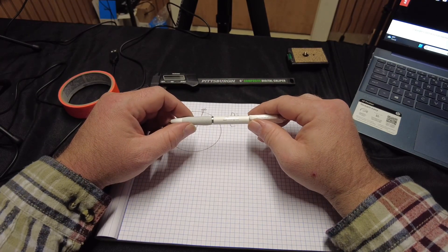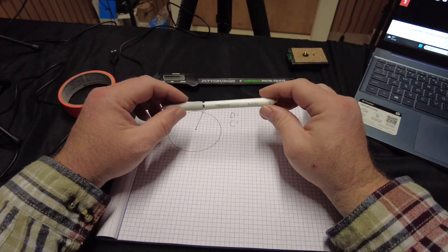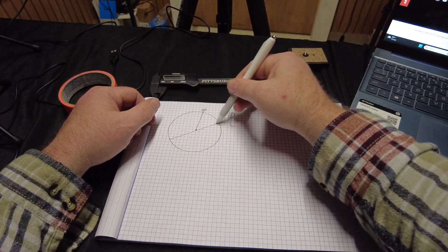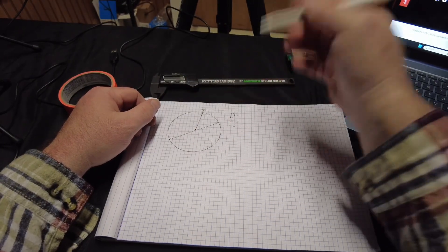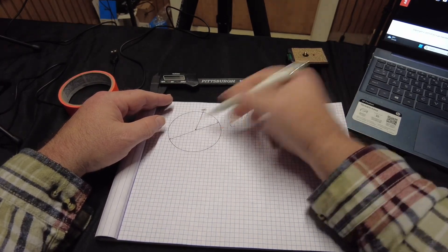If you're not really too privy on it, you know you can find top dead center on your balancer and make sure it's true top dead center — just a bit of math for you. One thing you need to know is the diameter of your balancer. Go take a measuring tape and measure across it. I did mine just a minute ago — it's 6.75 inches from point to point.